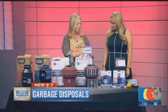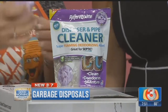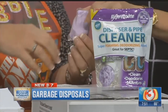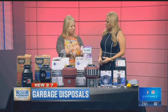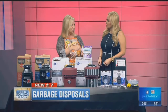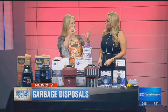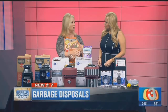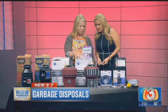This is a product by a company called Rejuvenate — it's a disposer and pipe cleaner, and it's biodegradable and all natural. What you do is run some hot water down with your garbage disposal on, then put it down to a trickle, put this in, and flip the switch on for about a minute. It foams up — don't be afraid. When the foam dissipates, your disposer is clear and your pipes are clean. It's all natural, so that's a great thing to do.